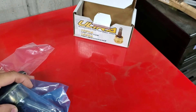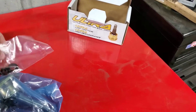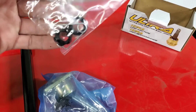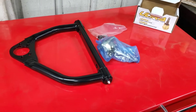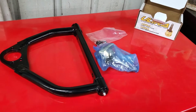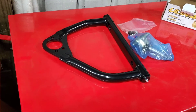Here's the kind of ball joint we're using. I did get this from Speedway Motors as well. It comes with a castle nut, washer, and a little pin. I hope this will fix the issue. It needs an alignment and there's no weight on the front, so that will change it as well, but hopefully I can get it as close as possible before I take it to the alignment shop.